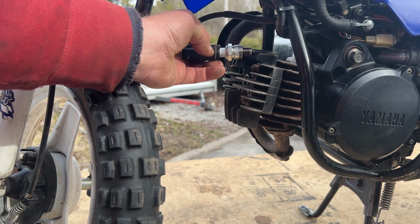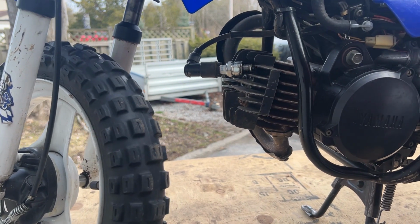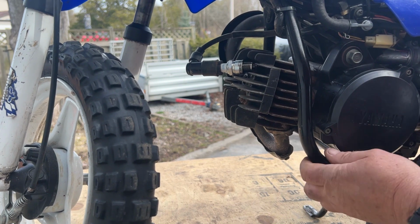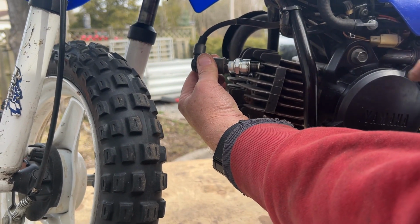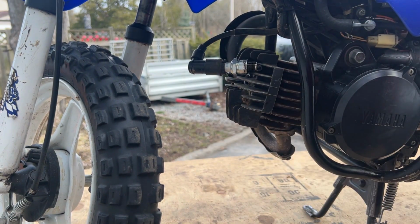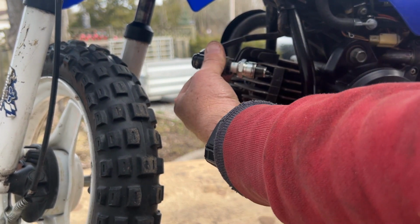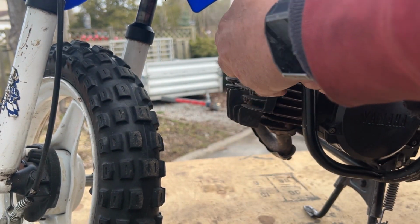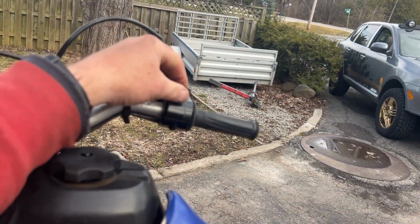Come on, you. No sparky. Let's move that switch around a little bit. Do you see any spark? I don't see any spark. Oh, wait. I see the tiniest little bit. A very weak spark. Just moving that switch around. Yeah. Very, very faint spark. And I don't know if this is the right plug, but we are getting spark. But I really had to wiggle this sucker around. So let's just replace it.